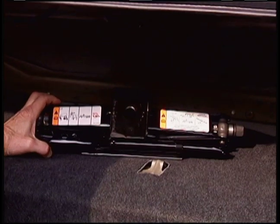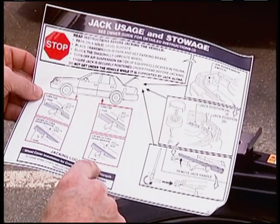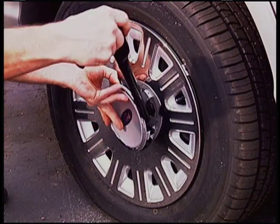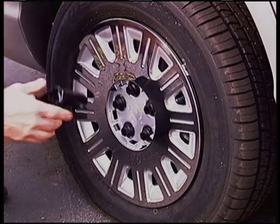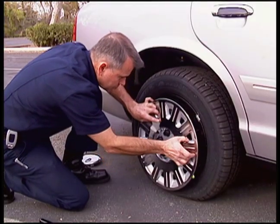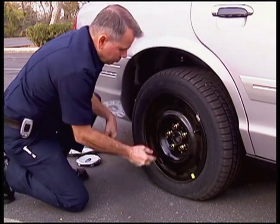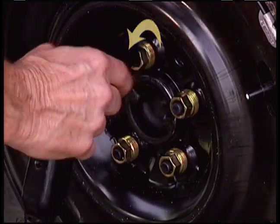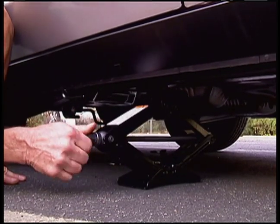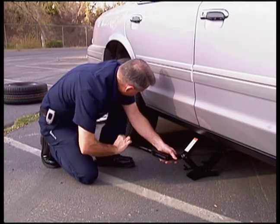Slide the spare tire out of the trunk and place it safely on the ground. Locate and retrieve tire changing tools. Refer to instructions for proper jack placement. If your wheel has a cover, remove the cap with the end of the lug wrench. Fasteners secure some covers — remove them to access wheel lug nuts. Prior to raising the vehicle, loosen each lug nut approximately one turn counterclockwise using the lug wrench. Place jack under the vehicle as per the manufacturer's specifications, and raise vehicle with the jack until the tire is approximately two inches off the ground.